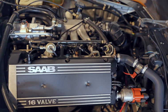The B204 and B234 are regarded by engine tuners as the preferable engines for performance tuning over the later B205 and B235 engines, as the internals are of higher strength. The later models had lightened internal components to improve efficiency and fuel economy, but limit total power output when engine software is revised to increase boost pressures. The B204 engine became a very popular engine swap for Vauxhall and Opel Astra, Calibra, Cavalier, and Vectras. In the UK it is swapped into rotary-equipped Mazda RX-8, and in Ukraine and Russia it is a swap option for Daewoo models of similar age.